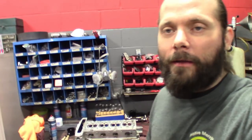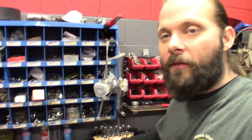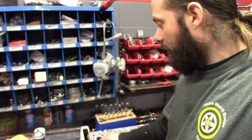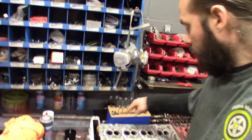All right guys, I'm going to wrap this one up. That's just a quick run-through of how I do a valve lapping job on a head — it's been a while, but basically you just want to stay uniform and keep the valves married to the ones you did it on. I don't know if you guys noticed when I sped it up — when we did this side I put them directly up, and then when I flipped it I went backwards, so they're all the same. That's just the way I like to have the angle facing toward me when I'm spinning it. Remember to like, comment, subscribe. The next one will probably be getting the head, putting the seals in and popping in the valve springs and all that stuff. Then we'll get ready to pop this head back on that motor, torque everything down, and get ready to time it. Catch you in the next one — signing out.